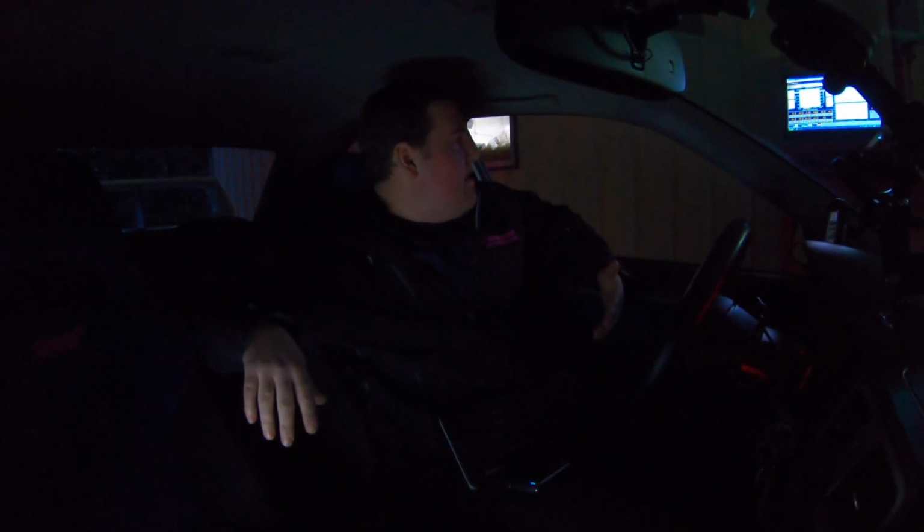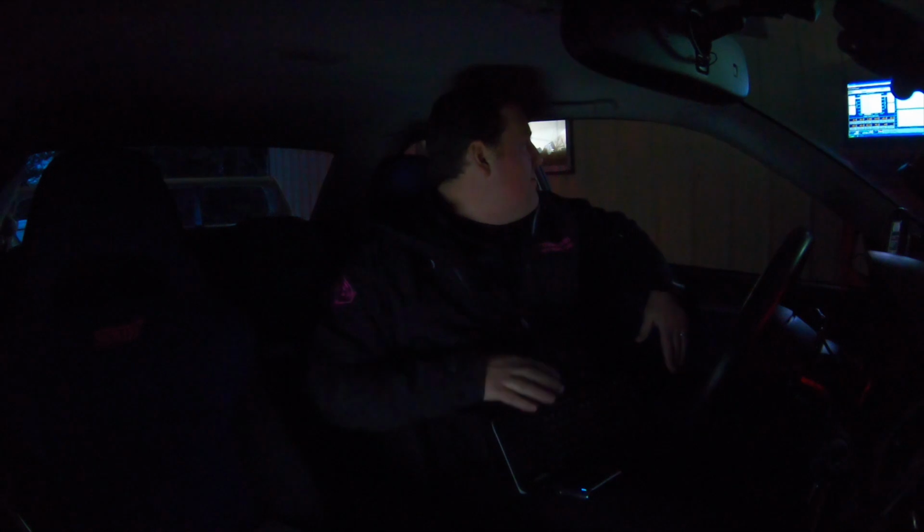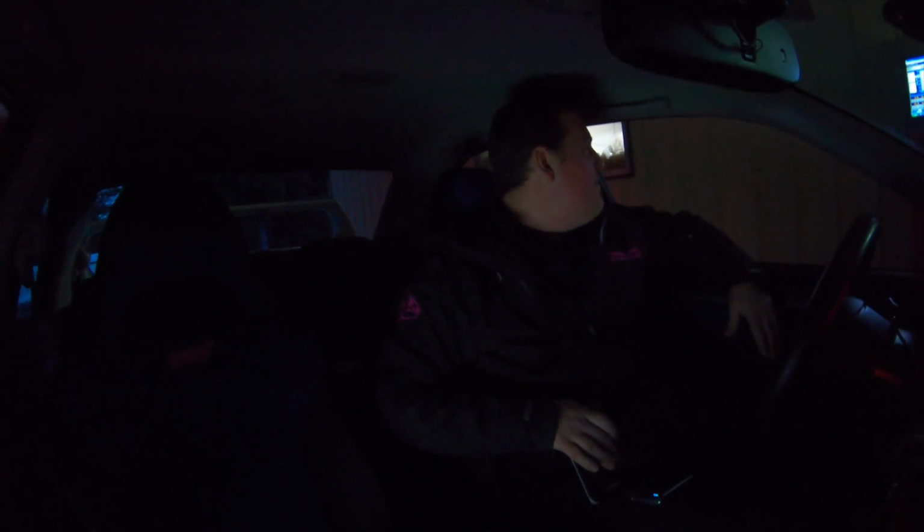We made 163 foot-pounds of torque on that last rip. And the same horsepower, 1 to 1. Sorry, 363 is what I thought you said 163, but I can't hear anything with these fans going out here. So we've made 355 foot-pounds of torque and 363 horsepower on that last rip, and that was after we had a lot of inlet temperature going on, so I'm pretty happy with that.